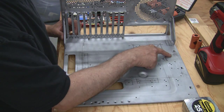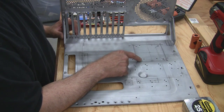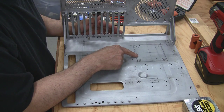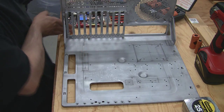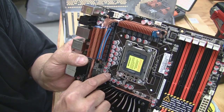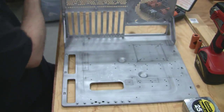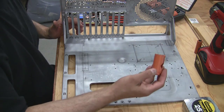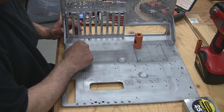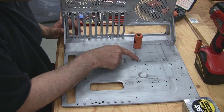And I've done that with all these holes. These here are just going to be a three-quarter inch hole, so there I didn't need to box it in. And this is a larger hole to cut, so when I go ahead and mount my CPU cooler, or if I ever have to dismount my CPU cooler, I won't have to take the whole motherboard out. On the motherboard, if you can see here, there are holes that are going to mount the back plate for your CPU cooler. I went ahead and measured from center to center of these holes and added a little bit. So when I cut this out, I'm going to use an inch and a quarter hole saw, cut out all four corners, and then take our rotary tool and cut out the remainder. You have to make sure that where these holes are and where you're going to cut out, you have enough room that you can still get a tool back there and take off the nut.